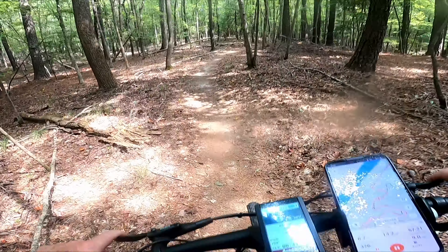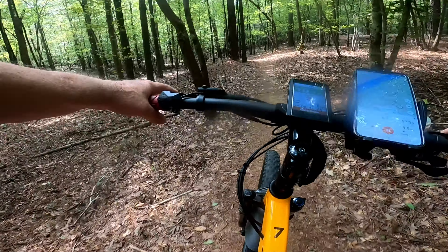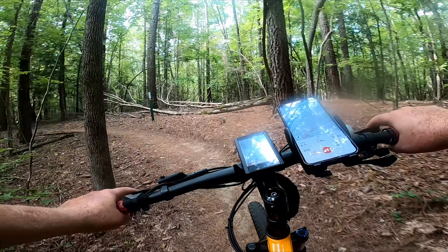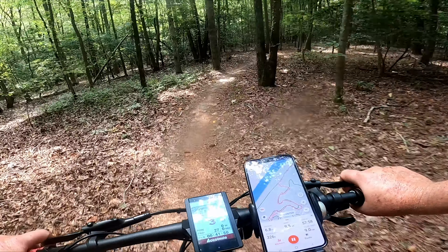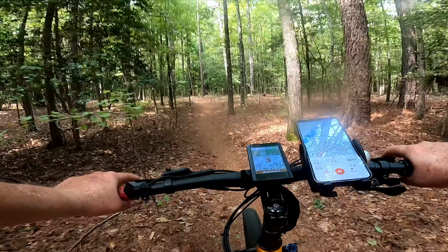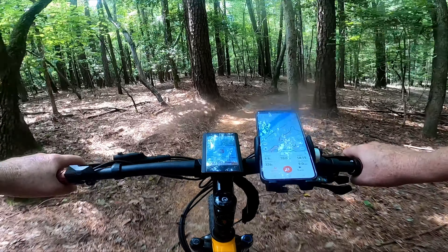That would be my first upgrade that almost has to be done. I don't need to be going 20 miles an hour max on this off-road, and that would really not even be taking place. So I don't need a great big 52 tooth chain ring. I've always run a standard 46 on this bike and it was good for maybe 28-30 miles an hour. Off the road here, at 42 or 44 it's capable of about 22 miles an hour. So I'm still going to drop this down to about a 36 tooth, maybe even a 34 or 32 tooth — standard on the Trek Marlin 7 was maybe 28, and I don't know if I can get one that small to fit.